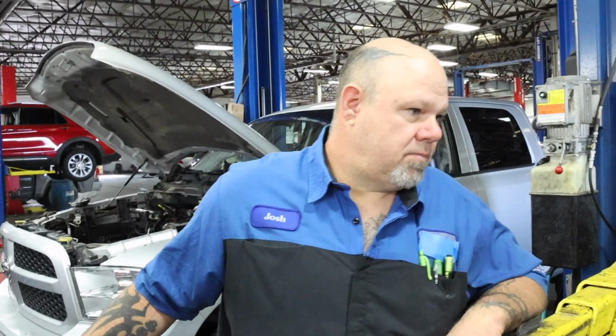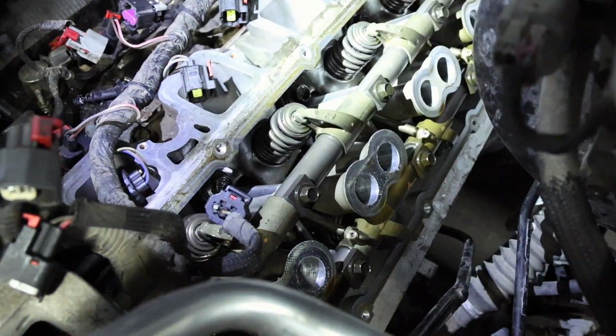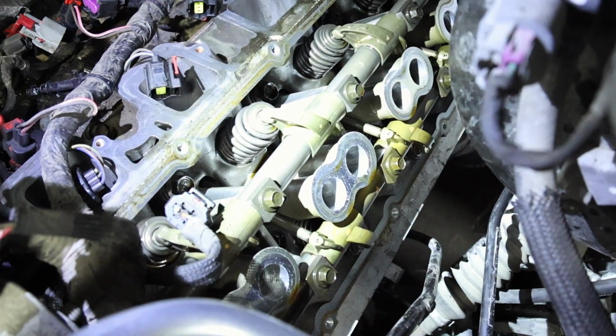Now, what broke off on this engine? Well, the needle bearings inside of the lifter fail. That's the start of it. Once those fail, the lash becomes more, and you end up with a lifter tick. If you keep running it long enough, that lifter will totally fail and start grinding into the camshaft. It's sad to say, but this tick has probably been evident, probably more so under power, for 10, 12,000 miles. So if your HEMI starts ticking, get it into the doctor. Maybe you can get away with just doing a camshaft and lifter and not having to replace your whole engine.